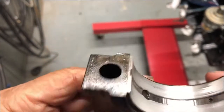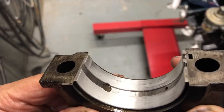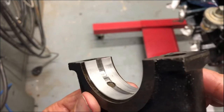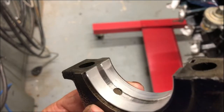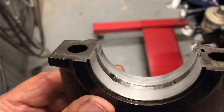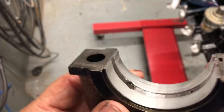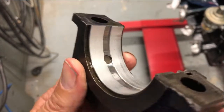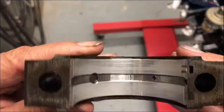Certainly, when I've taken it apart, it looks like it's not been together all that long. The only problem is there's an awful lot of silicone everywhere and double gaskets, like the rocker cover gasket, there's two of them, one on top of the other, and same with the sump. And then there's just silicone literally everywhere. Anyway, so I think that's pretty okay.